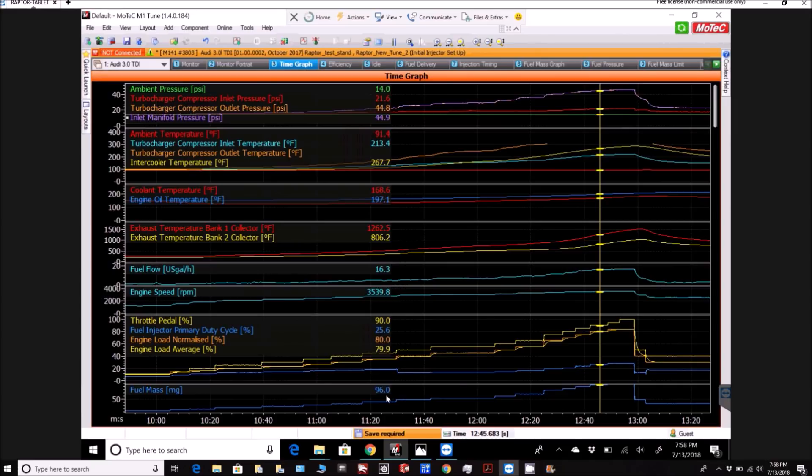My goal is now to try and remedy that somewhat. That should lower the amount of power coming out of the exhaust, which will lower the boost that we have for any given RPM, and ultimately even out the boost a little bit more for the amount of fuel being delivered.